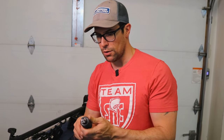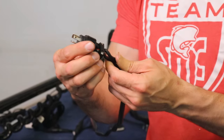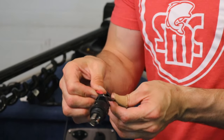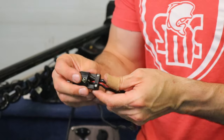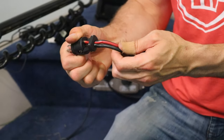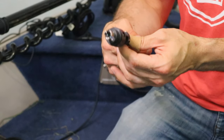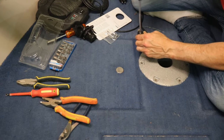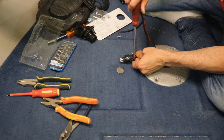Let's start with the plug. We're just going to take the old plug off — pretty simple, you peel back the plastic sleeve and you've got wires screwed into the receptacle. This is a three-wire setup. Generally you've got a black wire as your ground, and a black and red or black and white as your positive. The holes are numbered: number one is usually ground, number two is positive, as written right there. We're going to undo the screws on the side, pop out the wires, and don't forget to unscrew the clamp that holds them in place.